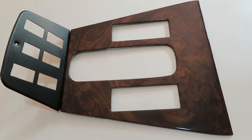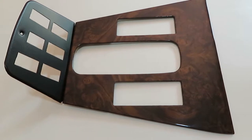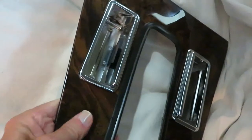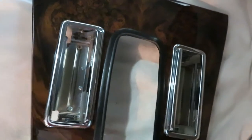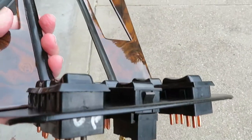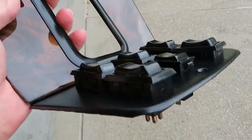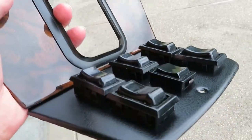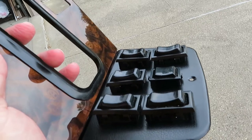This is the later Series 3. I'm going to put this on an 87 — I believe it was 86 and 87 that used this style. Remember, you've got to put the ashtrays back in before you put the panel back in. You can see I got this brace on the back and screwed it down in. Be sure and get it so they open towards the center. I've got all the switches in — just kind of put them in place, didn't snap them back in. I'm going to put this in the car, hook the wires back up without screwing everything down, to make sure all the windows work and they work in the right direction.